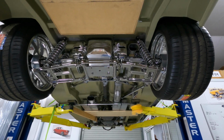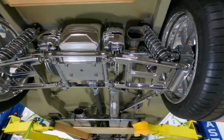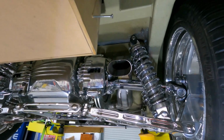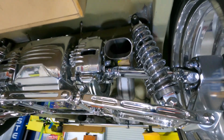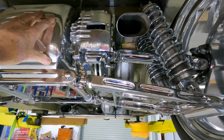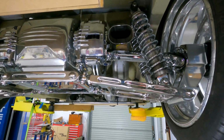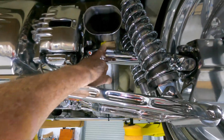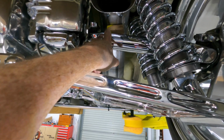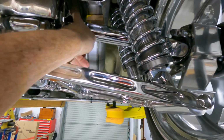So while I've been doing the extractors, I had Darren back here working on the rear. So you can see there just how tight that's going to be, but we've got enough clearance. So this centre section here is all fixed to the body, and the exhaust is effectively fixed to the body through the mounting. So the shaft here, and we've got about 20 mil gap in there, but this shaft virtually won't move here. It'll be very minimal because all the movement's on the outer edge out here, and this point here is fixed.